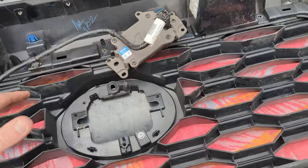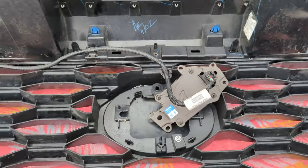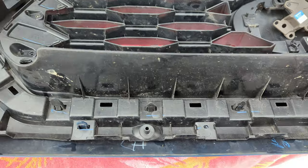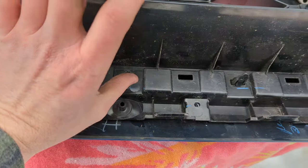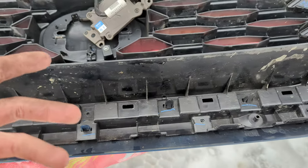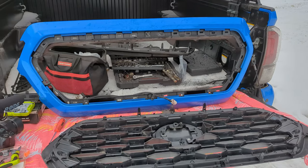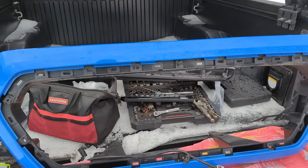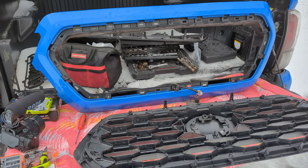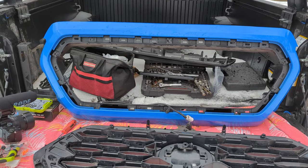Now that we got the sensor removed, I'm going to leave that connected. I did just pop that little clip out — just give it a yank and it'll come out. I'm going to leave that installed because we're pushing this grille out. See these little tabs here? You have to push in on these and down, just like the other tabs, to get those out. As you can see, we just got the grille completely popped out. Not too bad. I'm going to get the other grille prepped and ready.